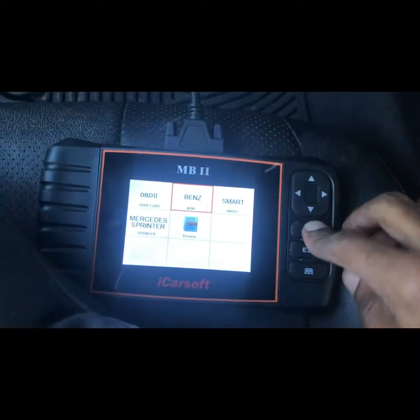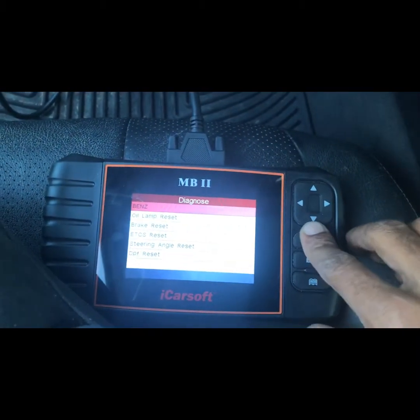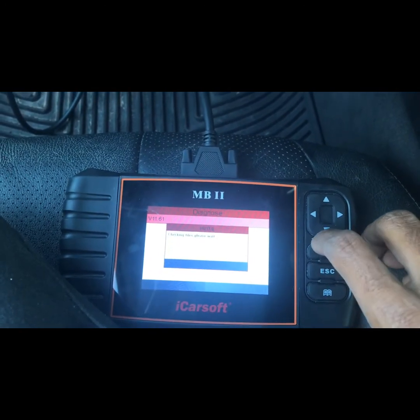He told me about the ABS/ESP light. There are two little sensors on the actual master brake cylinder. When I go to check this with MB2, I can read the pressure off of them — one was reading 255 bar and one was zero, and they're both supposed to be zero at rest. I'll show you on the screen.